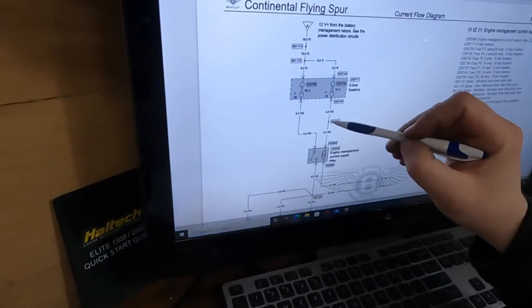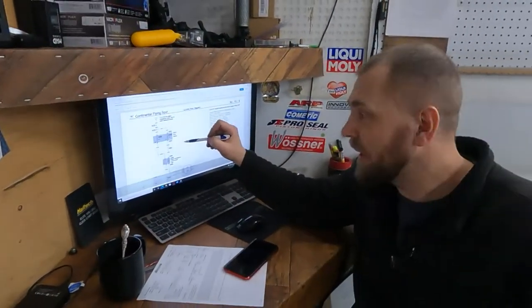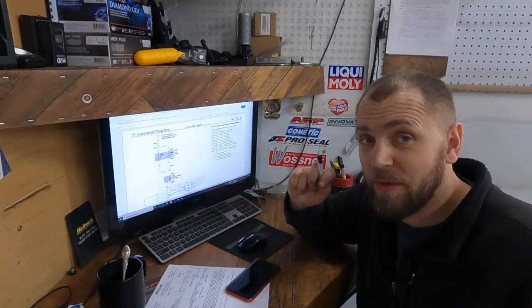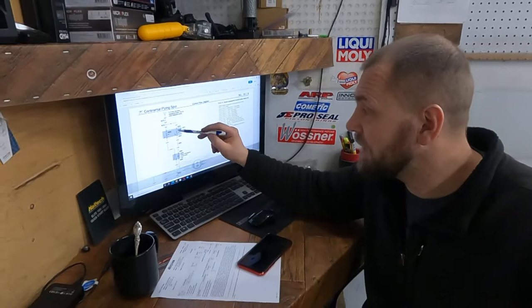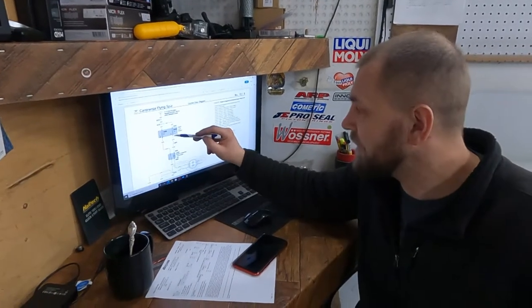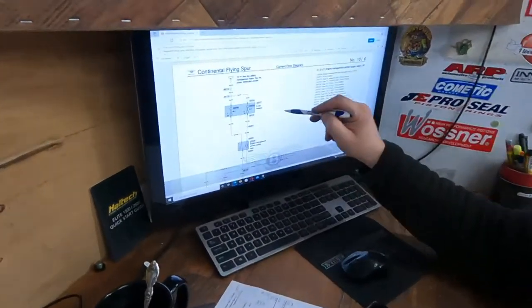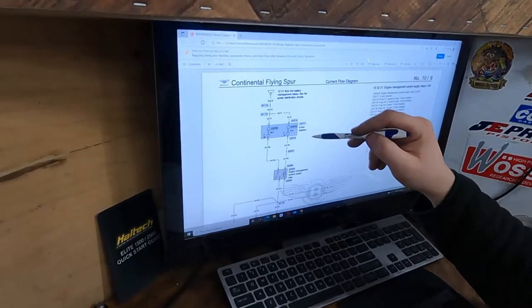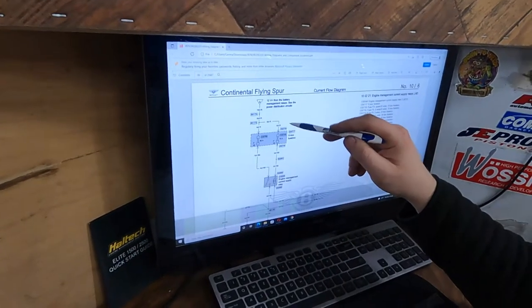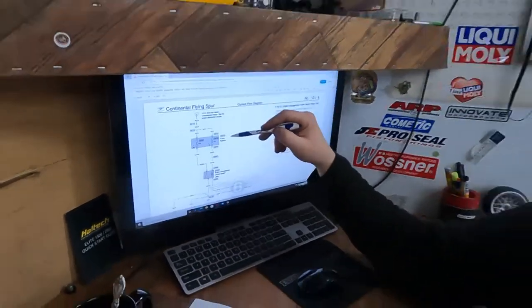This wire has disappeared. It's corroded. I don't know what happened with this, but the customer didn't tell us. He tried to fix it by himself. We just see these two relays are exactly the same. We see one power wire going from one relay to the second relay, and actually we don't have the one more power wire from the fuse. It disappeared. We don't know what happened.